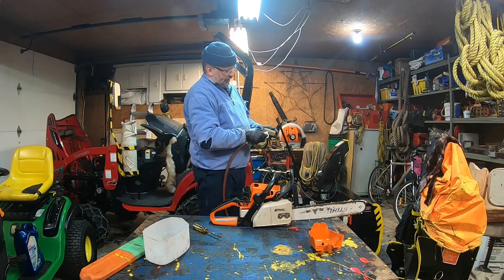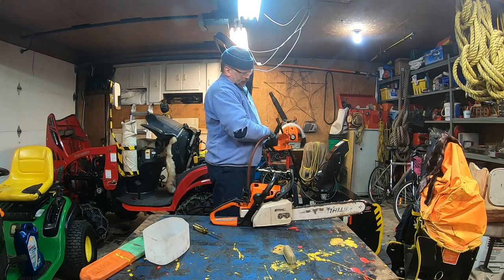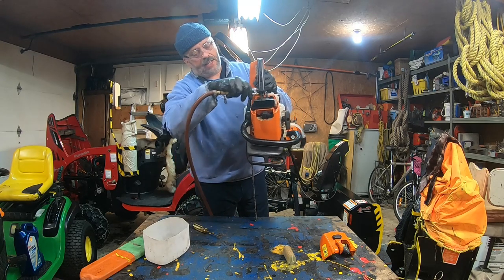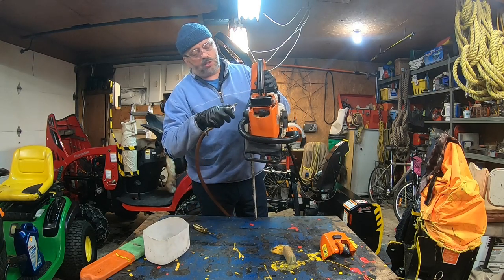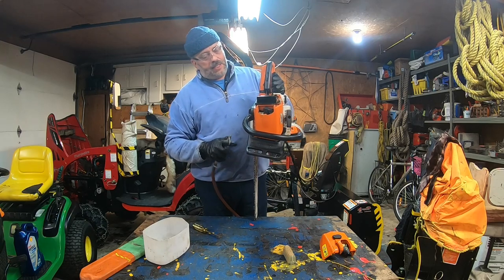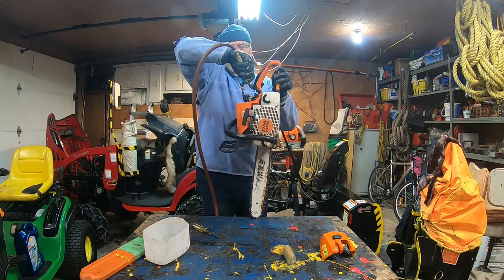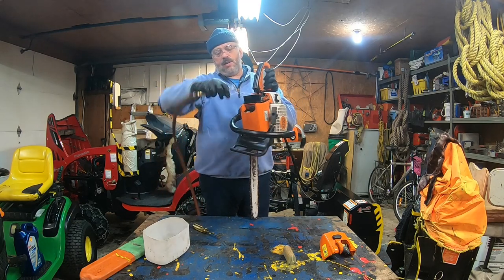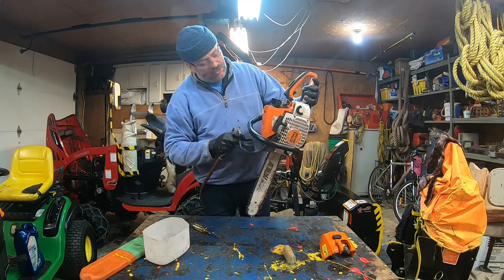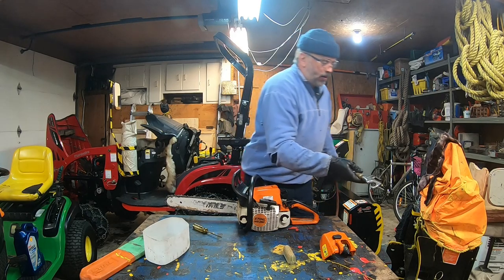All right. Then I'm going to take the cover. Same thing. Now all around the spark plug area, this is where you don't want to put any air, not directly, because it breaks the little choke valve, basically. So just a little bit of air like this on the side. Now here where the spark plug is very important. Trust me, a lot of dust.